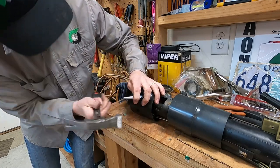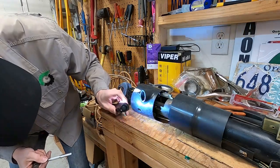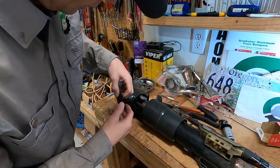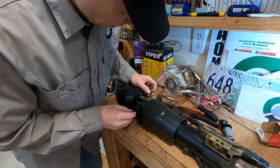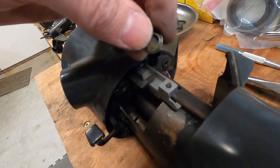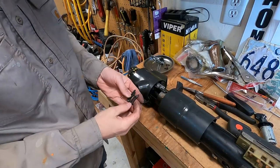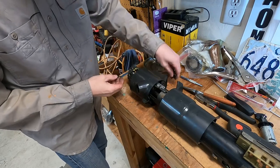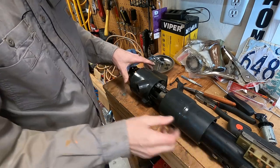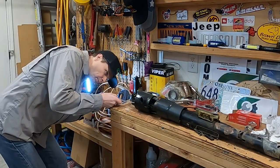I'm just going to drive it down so it sits in there. It's seated all the way down and catches those gears nicely. The gears look great, they're all seated down nicely. Now I can put our key release back in - the good part about this is I'm getting better at it doing it over and over. Now there's one last tiny little washer that goes over the end there. Next, four little eight millimeter bolts are going to go on the inside of the column here. We'll get these in place to hold all of this together so that we can then put our key cylinder in and test it out, make sure everything works.